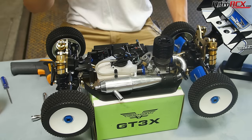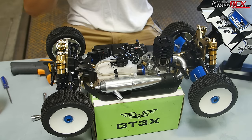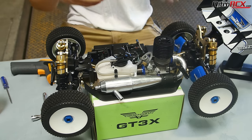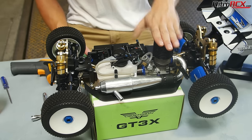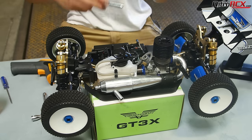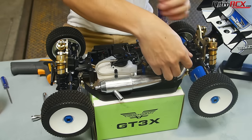Notice as the engine gets hotter, the sound starts to change — each individual pop starts increasing, which means it's getting hotter and burning fuel a little faster. Pretty soon when it gets too hot, it'll pass that threshold where you start hearing pinging — pop, pop, pop, pop — and that's when you want to richen it to get it to settle down.